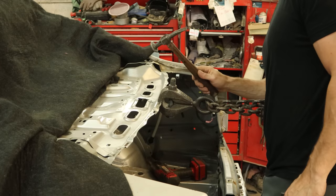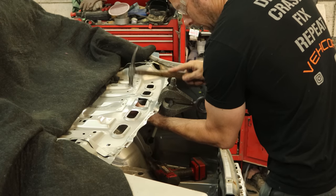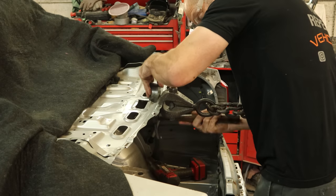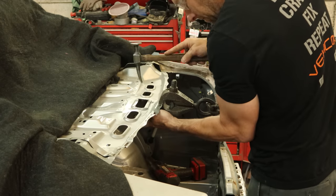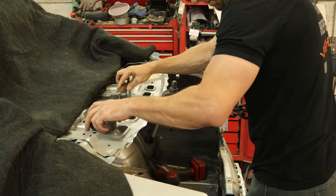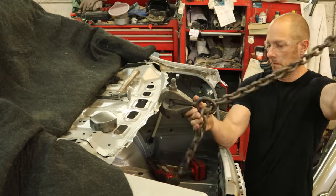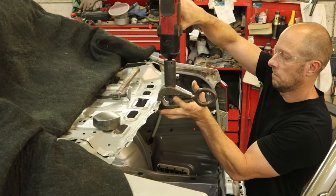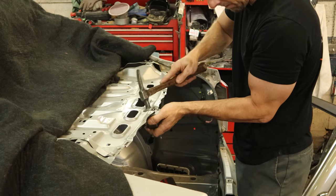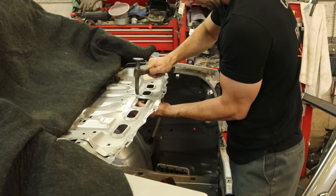Now that I've gotten the green light from the tool experts to use my body hammer to hammer out the body, we're going to hammer the flat parts flat and the curved parts we're gonna put our curves back in — basically put it back the way it was. Once it's back there we'll release our tension, hang on to that clamp before it undoes all of our straightening work, unbolt it, and then we'll straighten out the part where our clamp was. Leave some teeth marks in there and get those out with hammer and dolly.